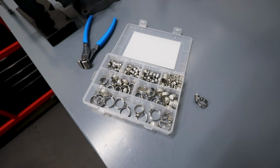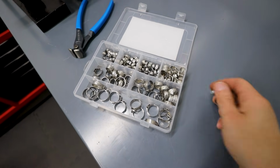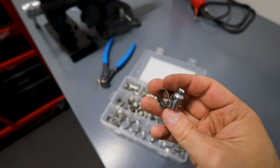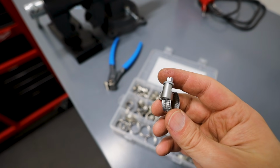If you end up going down the flexible hose route that I'm doing, obviously you'll have to find a way to secure your fitting to the hose. Two options more or less. First one is the obvious one, good old-fashioned worm clamp. I won't explain it very much. Reusable, which is great. It doesn't look amazing though, and you know, it's secure, but it can loosen over time.